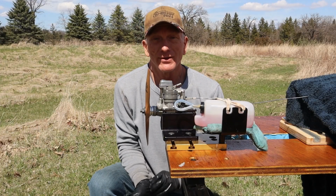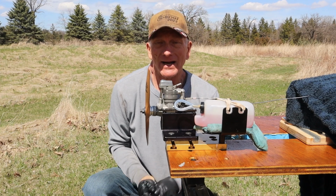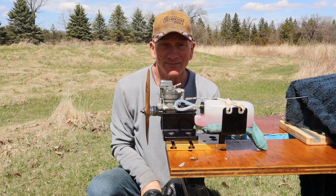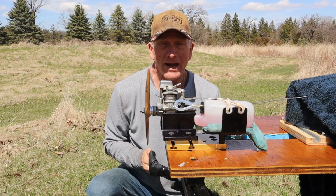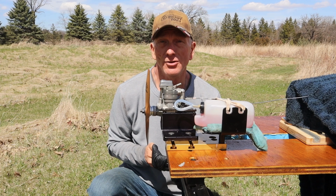So that's a smoking nice little engine. I really like that. It runs really well. I think obviously it needed a little bit of air bleed adjustment, and it might need a little bit more. But the thing with the air bleed adjustment, Steve, particularly for you, is that it's very dry here. Air bleeds are very much affected by humidity conditions.